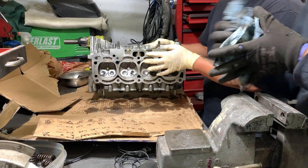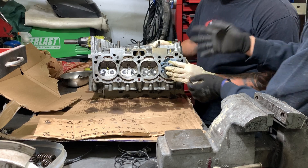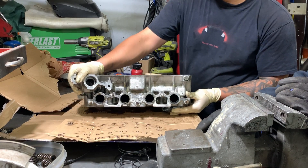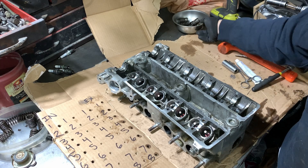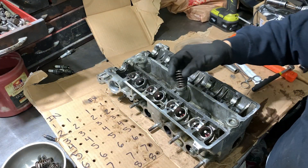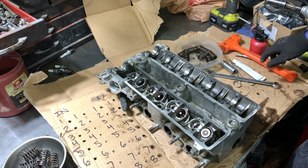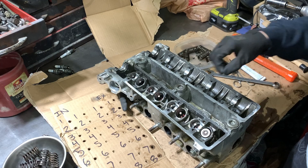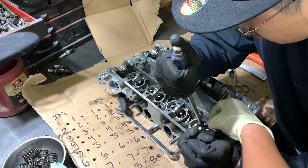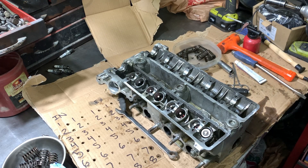So this is what we're going to do — we're going to grab these rags and shove it here, and when we put this down it's going to keep the valves from dropping. While the valves are in place, I'm going to do the first one and then you can do the rest. This is exhaust, and then we have a retainer here. These are a little tighter than go-kart springs. The next trick is dropping it and getting this one in — skinny side down, taper down. There we go, nice. Now we got to do that for all of them.